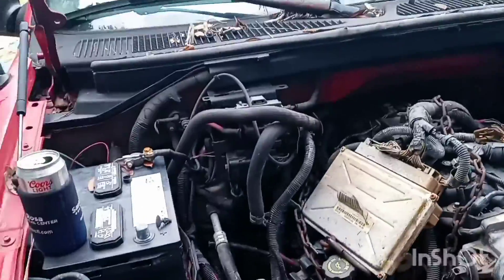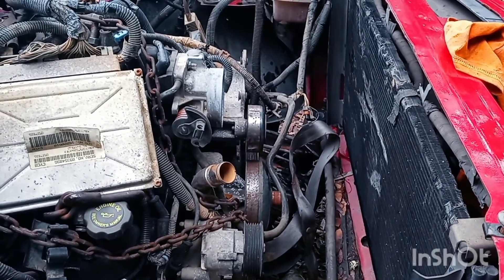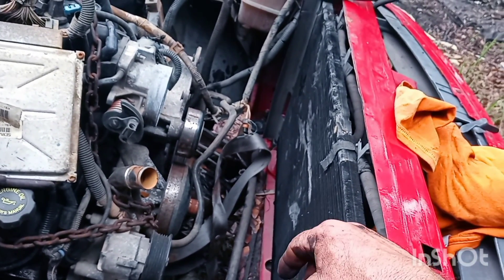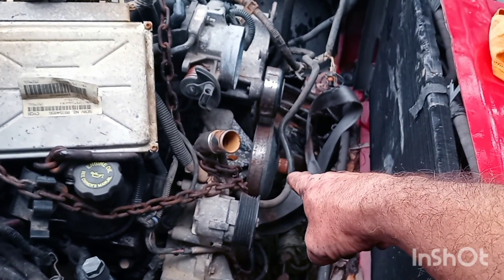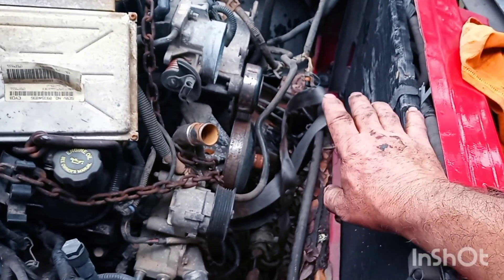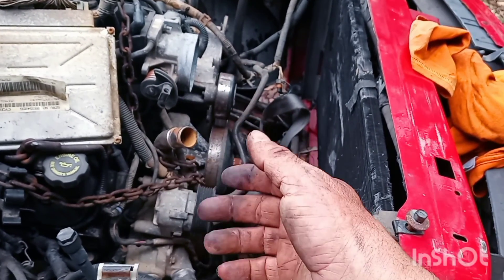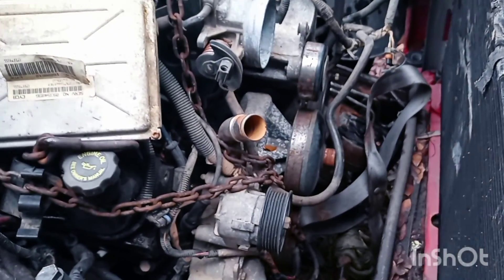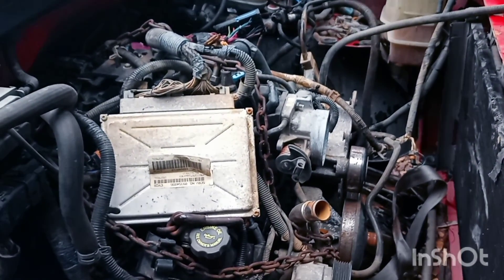That is a very good fit — the LS went right up in there. I think I'm gonna have enough room for my fan to clear the radiator. The radiator's gonna sit right here, tight to this. I may have to remove the AC condenser for now — air conditioning might be something I do way down the road. I'll get my radiator in, get that all hooked up. I'll need to move the motor up and down to build my motor mounts, since there's nothing in there. I could probably order aftermarket mounts, but basically I'm going to build them myself.